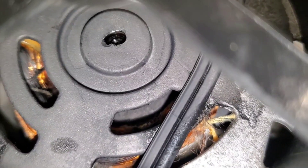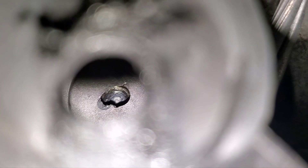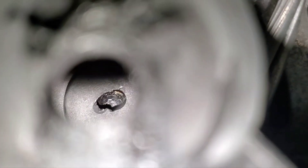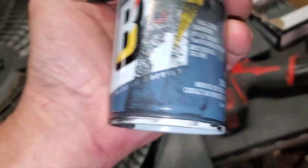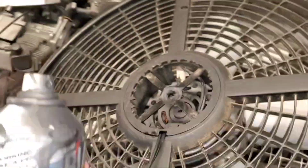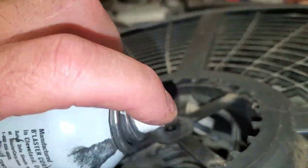You can see it's the motor bearing — when I turn this blade with my screwdriver, you can see it turning. So what you do is put your spray oil or grease — whatever you've got — in there. I happen to have dry graphite, so you can actually spray dry graphite down in there.